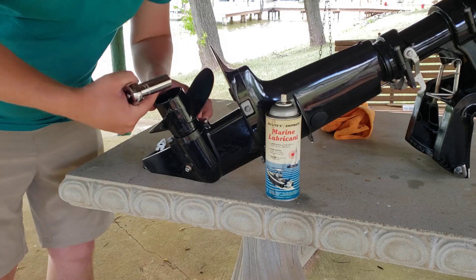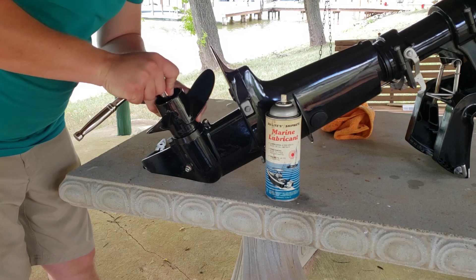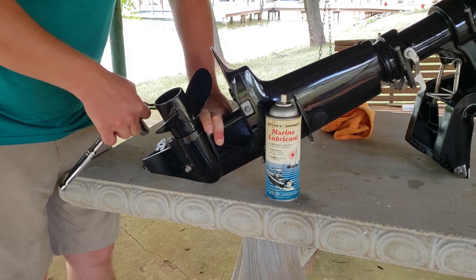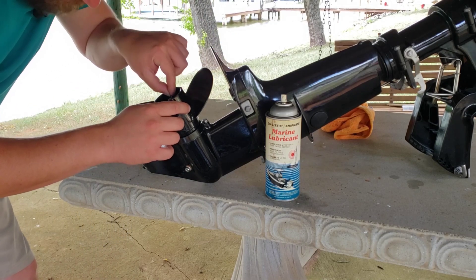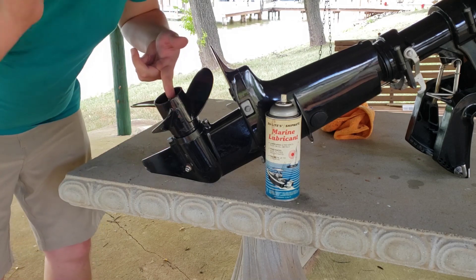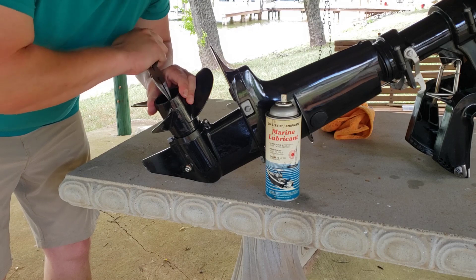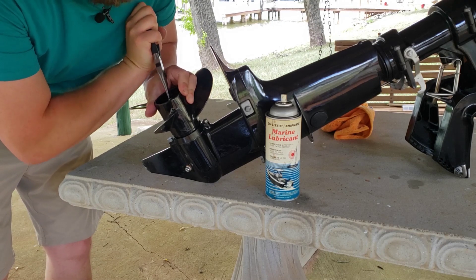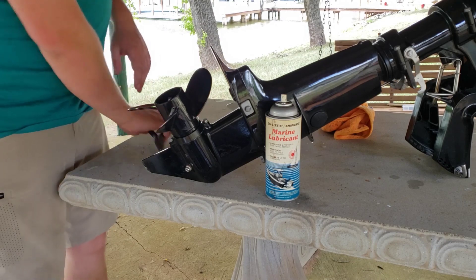As you do this, the hole that goes through the shaft for the hairpin — you've got to make sure you line it up with the castle nut. I've tightened it down just a hair — that feels about right to what the previous one was. Now we can push our hairpin through here, then make sure you pull that one tab of the hairpin back up so it does not come apart. Push that back down, and there it is installed. We're going to throw this on the dinghy and give her a test.